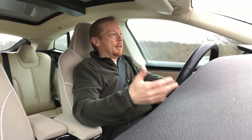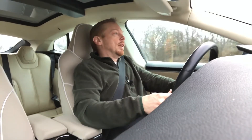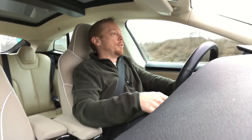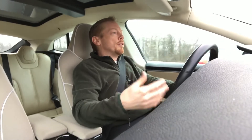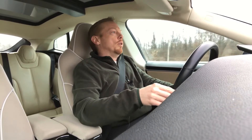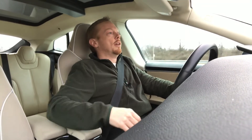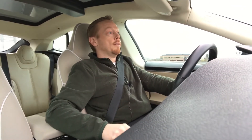Breakers are cheap — usually under $10. I swapped the breaker and that one's been in there ever since. You want to stick with the manufacturer of your box; you don't want to be mixing and matching manufacturers, generally speaking. The other thing to consider is if you have a destination charger nearby, or a public charger — in my case I would go to Ross Park Mall, where they have HPWCs in the parking lot at the Tesla store — I could test it there. That way I would know that both onboard chargers are working, and that would help me rule in or out my personal UMC.